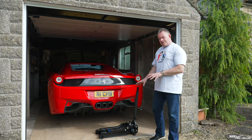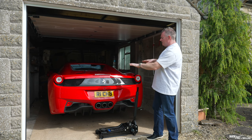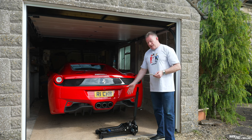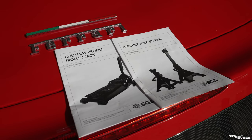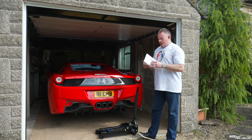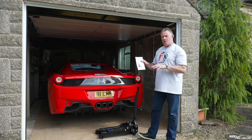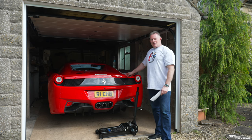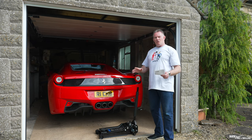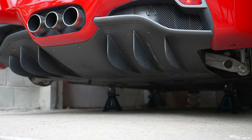In addition to these specific tools, you'll also need axle stands, because once you've taken the wheels off you need to keep the car safely elevated for quite a bit of time. The ones I purchased are SGS — same brand as the trolley jack — very well priced and well engineered. I chose three-ton axle stands. Each one can take three tons in weight, so one axle stand alone can take twice the weight of the whole car. That's what this car is elevated on at the moment.